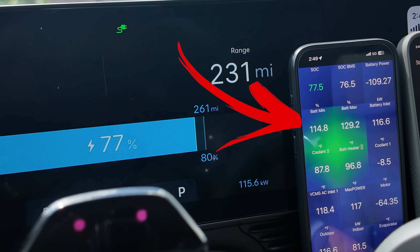The good news is that once you do that first battery conditioning cycle and get the battery up to 70 degrees, and then you pump in a lot of extra heat from the DC fast charging process, that'll bring the battery pack up to about 120 to 125 degrees Fahrenheit. Then when you get on the road and you're an hour and a half to two hours away from your next charging stop, the battery doesn't need a whole lot more conditioning between charging stops — the time needed to warm the battery pack will decrease significantly. But because Hyundai doesn't give you an actual battery temperature readout, it's just going to say 'battery temp low.' You can keep activating it as many times as you need to.